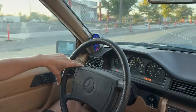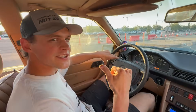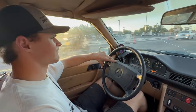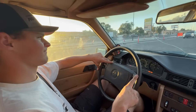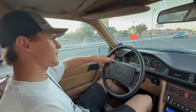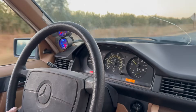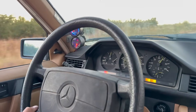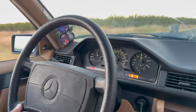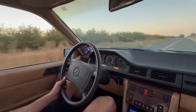We'll do a full zero to 60 rip and see what gains these sticky tires give us. So now it's the HY35 with sticky tires and the crack welded up with an aftermarket wastegate. It should spool a lot faster and we can boost it up to 50 PSI. With the intercooler this time - let's see what the spring pressure is. It's still like 13 PSI spring pressure, so that means it needs to get turned up to at least 30 PSI.